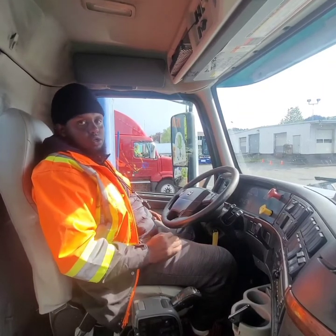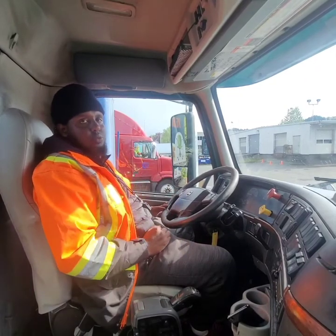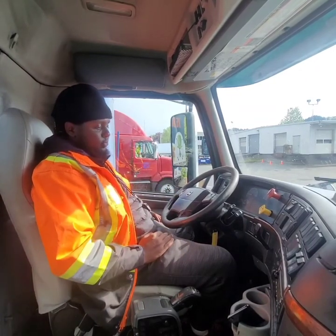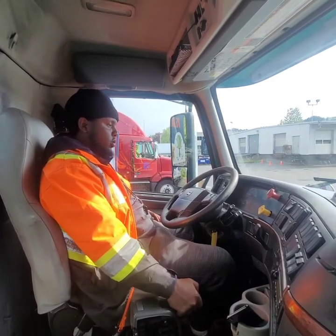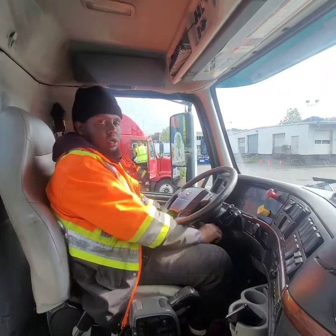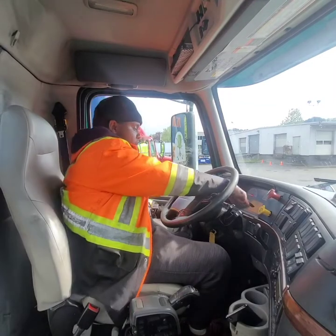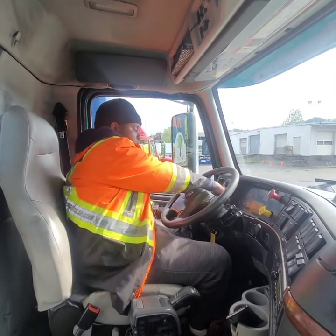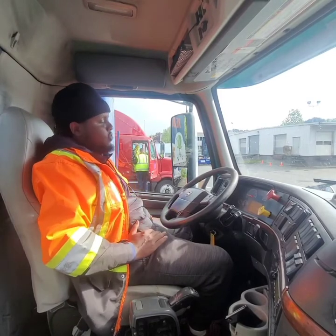Once the examiner is seated inside, I will start my safety start. Making sure the transmission is in neutral, the brakes are out, I apply the brakes, and now I turn the key on — not the engine, just key on. My ABS light came on and off. Examiner, my DEF light came on and off — the truck has one-eighth of DEF fluid remaining.